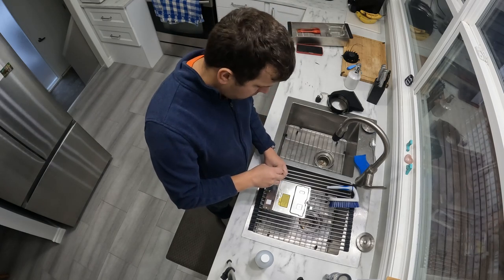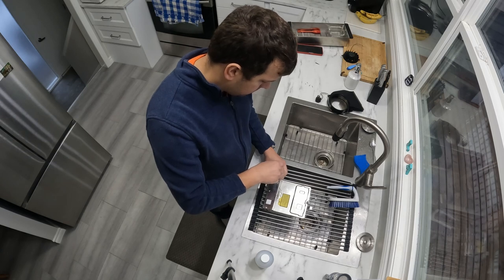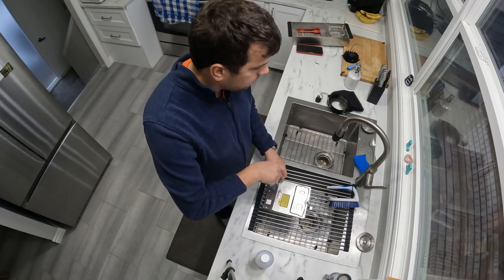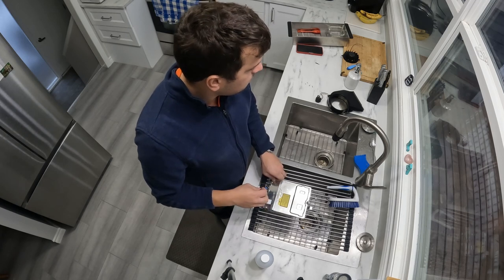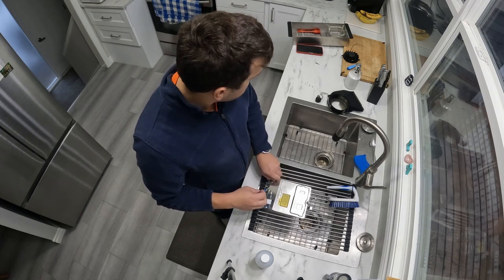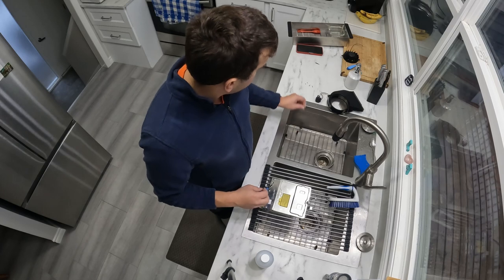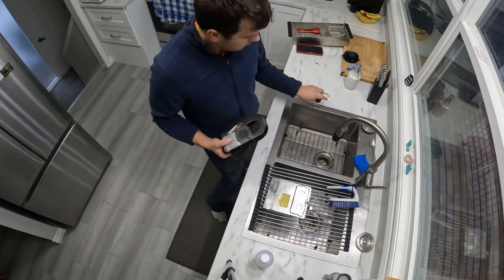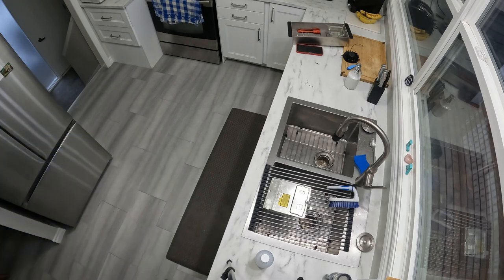So we're going to start taking out the screws on the Blu-ray drive. We're starting with the bottom first. There's two long ones on the back of the PS3 Blu-ray drive, and there's three screws in a triangle configuration. The two in the back of the drive are the long ones that bite into metal. The three ones are the ones that bite into plastic.